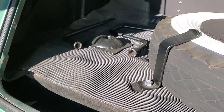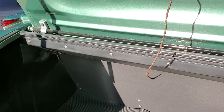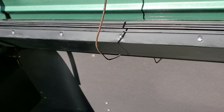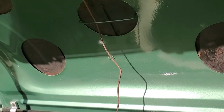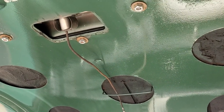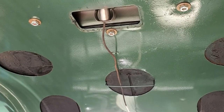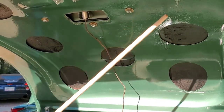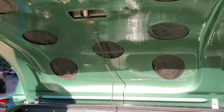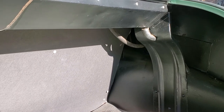Up here on the top you have a rubber seal that starts out as a bubble on the top and has a little T-rail this goes into. This comes from Metro Molded Parts. Up here you'll notice this is the way they ran the wire for the tail light — through a little wire clip and up to the top. This is an NOS tail light wire. All of the parts in the actual trunk here are original and were refinished using rubberized undercoating to make them black like they would have been. On the sides you have a rubber hose here and a rubber hose here — originally these were molded rubber hoses that Graham put in to direct water from this trough out the wheel wells.